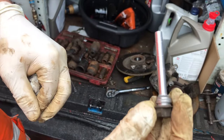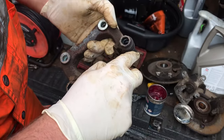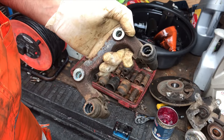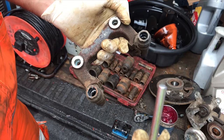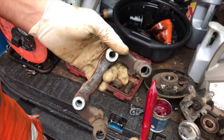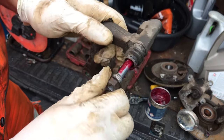Is that bad enough to warrant replacement? No. Inside here is actually pretty clean already. If you could see loads of grease build up inside the pin holes, you might want to clean them out. There was so little grease in there before it pretty much all came out on the pins. So what I'm going to do is grease up these pins with red rubber grease — it's safe, it won't react with the rubber boot, and it doesn't really dry out either. Great for lubricating slide pins.